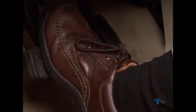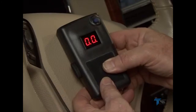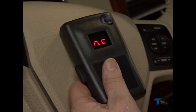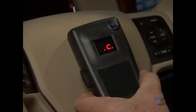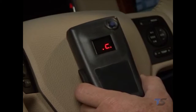Press and hold the vehicle brake pedal. The display should change from PA to flashing zeros, indicating that the units are paired correctly and that the vehicle brake pedal can be released. Now dial the power wheel up to an output greater than minimum. Since the trailer's 7-way plug is not connected to the trailer-mounted power module, you should see a flashing N.C. The last step is to firmly connect the trailer's 7-way connector to the rear of the power module. The remote handheld display will now show a dot-C-dot for proper connection, indicating that the remote handheld unit can see the electrical connection to the trailer.